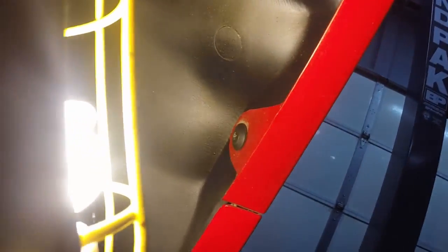The liner is now back in. One of the hardest things you'll ever do is put these screws back in — the main reason is because it wants to move around, so you're going to need a light to make sure you're lining up the three seven millimeter bolts. This is the passenger side and as you can see all the wiring is up above. The inner fender is back in. I took a little time and cleaned it — it's not super great but way cleaner than it was — and I did spray a little flat black paint on the liner itself. Make sure you put all your connections back: the three seven millimeters, your threaded inserts, another one here, one on the bottom, and the two 10 millimeters on the underside of the front.